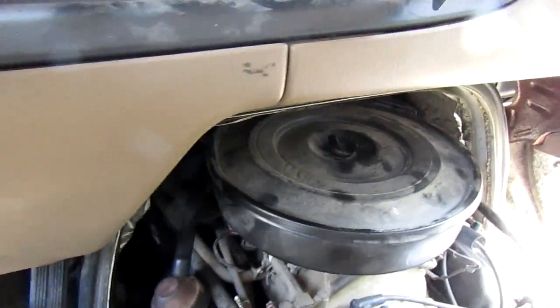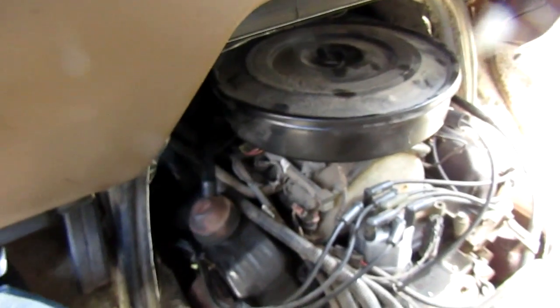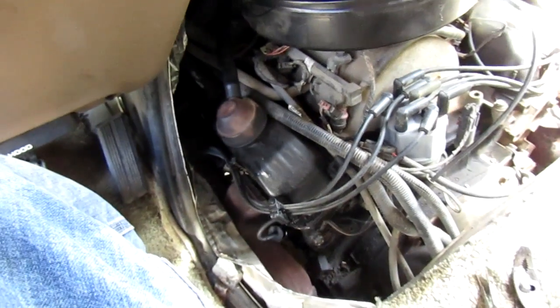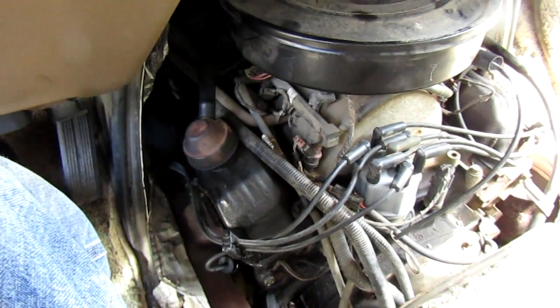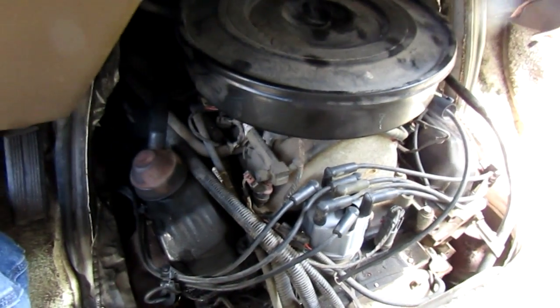There is something when you go to the auto parts store, though, you've got to be careful about. Here, let me clean one of these up real quick so we can read it. Okay. So whoever did this last time, let me start again. When you go to the auto parts stores, I wanted spark plugs for this. Some good old Champions, AC Delcos will work just fine. You don't need anything fancy for these motors. These are not high performance motors. You don't need the Platinums and you don't need the NGKs and all the other good stuff, because all they're doing is trying to upsell you. And if they upsell you, that makes their store look better because they're making money.